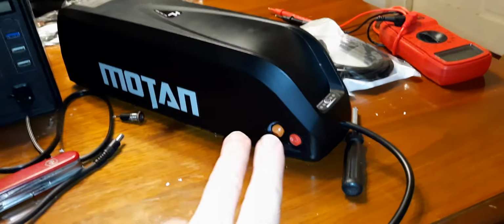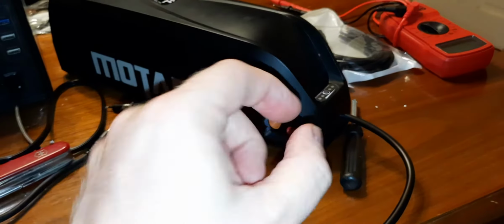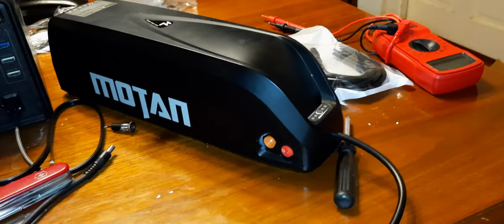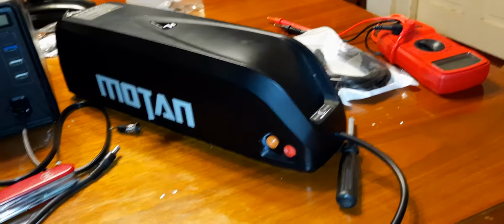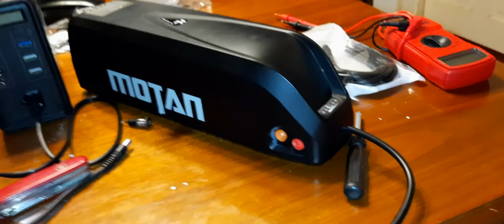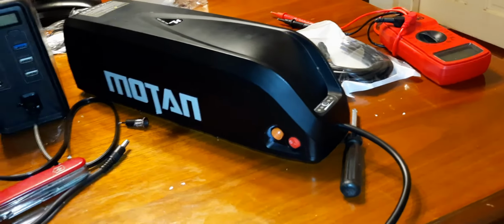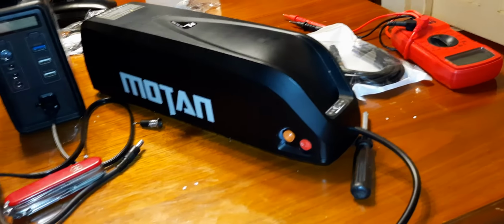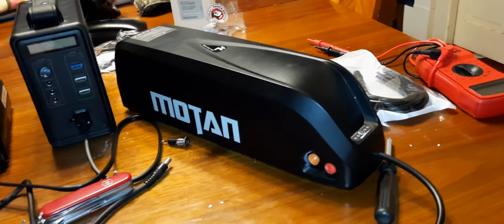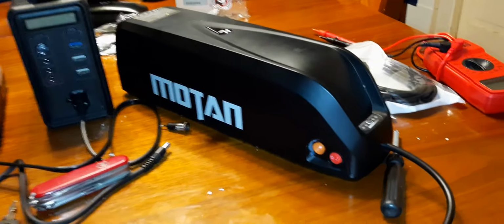Like I said, you got to get the polarity right, and you got to keep those from touching anything. The minute you cut those wires, you want to put a wire nut on the end of them so they can't just dangle around in there while you're working and short the battery out. Always keep them insulated or covered until you're ready to connect them, and connect them one at a time. If you try to do it all at once, you're going to have all kinds of crap happen. I am not responsible for your stupidity. You do this at your own risk, and you accept your own knowledge levels. So that being said, that's what I wanted to warn you guys about.